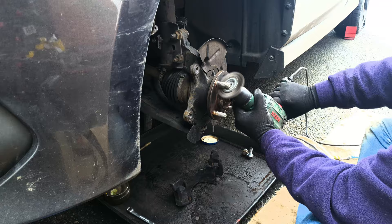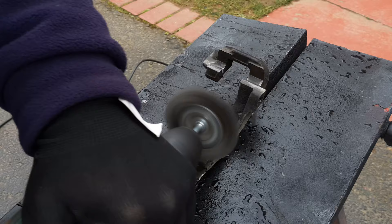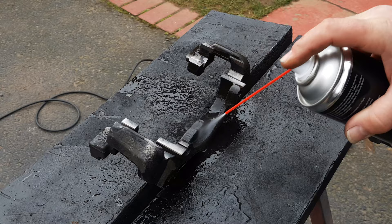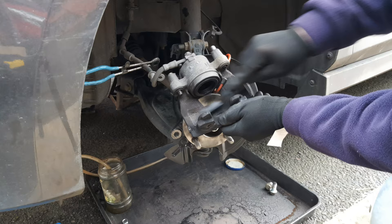Use a variety of brush shapes to get the flange as clean as you can. Pads run in the carriers, so give the carriers a good clean where the pads run as well, and just give the rest of the carrier a once over to get the worst of the dust off. Give it a wash down with a bit of brake cleaner — don't blow the dust away, you don't want to go breathing it in. Make sure the mating face where it mounts is also clean; again wash the dust off with some brake cleaner.